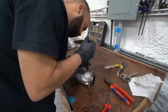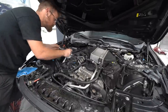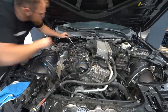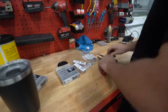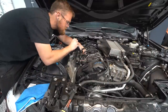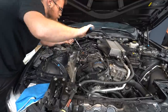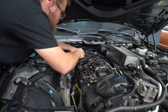While Josue was working on getting those wrapped up, my spark plug socket came in, so I went ahead and got the spark plugs swapped out. It's going to be a lot easier to do this now while we have everything apart. I wanted to make sure all the spark plugs would come out cleanly because I don't know if they've ever been out of this car, and if they haven't there's always the possibility of one breaking off in the head. Fortunately they all came out. We tightened up the gap just a little bit to extend the service life for what we're doing with the car and went ahead and got them reinstalled.